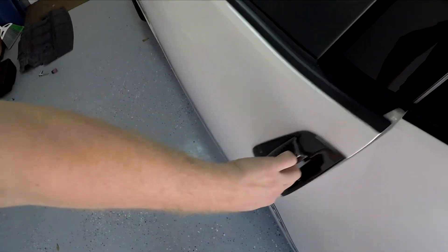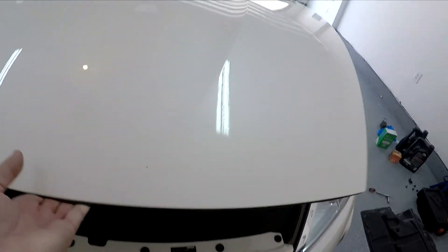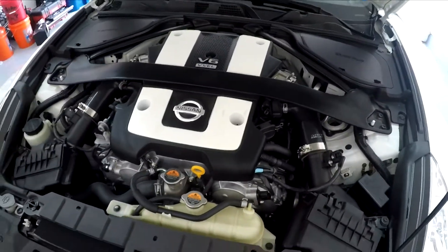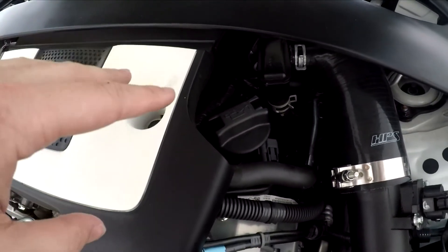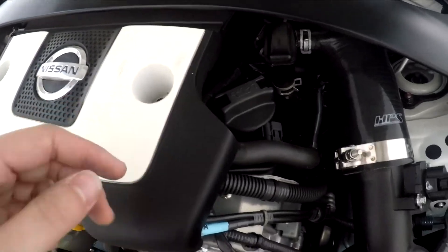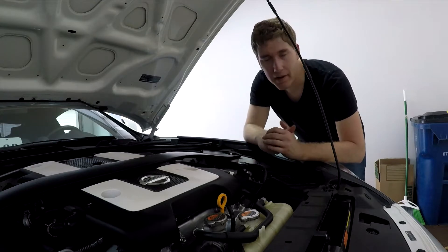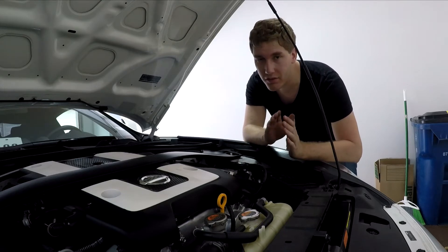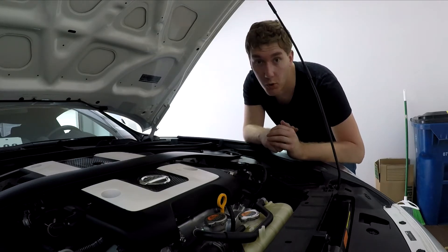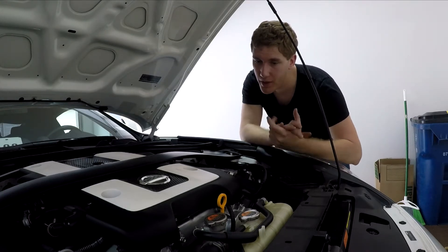Next step, we're going to need to go ahead and pop the hood. If you look right here, this is our oil filler cap. We're going to need to take this off so that we can allow air to get into the system, so when we drain it, the oil can actually flow out freely. Now unfortunately the engine is still quite warm — hot in fact — and I don't want to start draining the oil until it is cooled. So before you guys start draining your oil, make sure that your engine is not hot anymore; otherwise you could burn your fingers. We're going to wait about 30 minutes for the engine to cool, and then we'll get back to it.